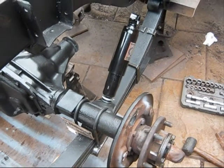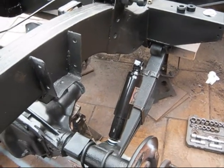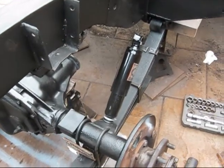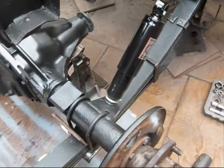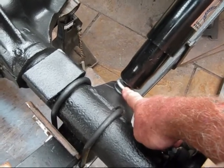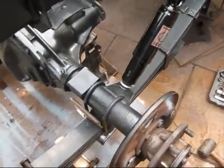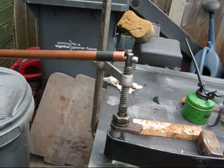That's what it should look like. I think you'll find it easier to get the shock absorber up onto the top pin. The bottom bracket is a pain to get the bushes on — I think I've done the bushes the right way, but check how you remove or put them on. You'll find the washers are so-called handed: the smaller ones with little cups either side, then the big fat washer — one's a bigger hole, one's a smaller hole. Should be self-explanatory. Then you should be able to pull that up with a little bit of help from your jack and attempt to put the back shackles on.